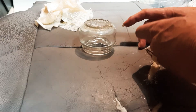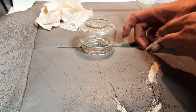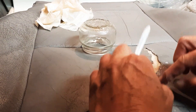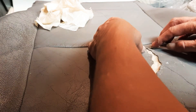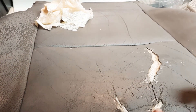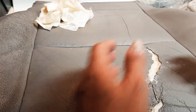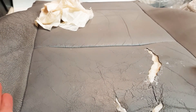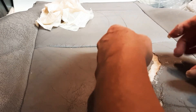Even seat covers for this are expensive, especially the real good leather ones, and it's a big nightmare to take them apart — you need hog ring pliers and hog rings. You can buy a set of used seats on eBay for like a thousand dollars. If I do this on vinyl or leather it comes out pretty decent. I'll probably put a thin layer of foam here and two thin pieces on the sides to really support it nicely. You can also buy new foam pieces, but you still need the hog ring pliers.